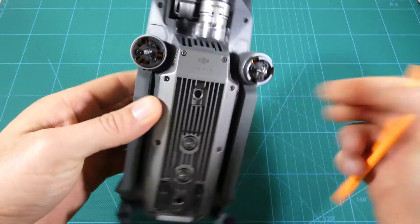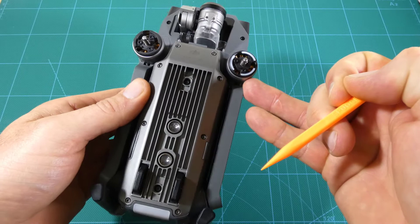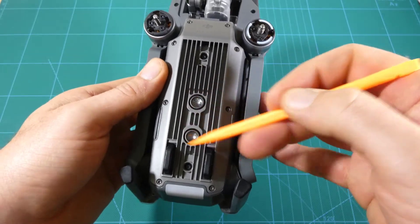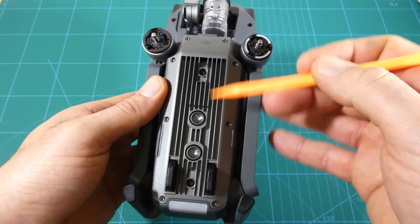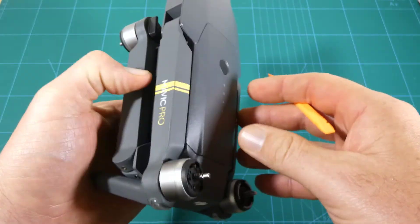We really need to be able to test that properly. Testing just one or two spots isn't really going to tell you much, because the heat sink may heat up differently depending on what's under it. There might be a processor under one area, nothing generating much heat under another, or something else back there generating a lot of heat. So you can't really test one little point — you have to look at the overall heat distribution of the unit.